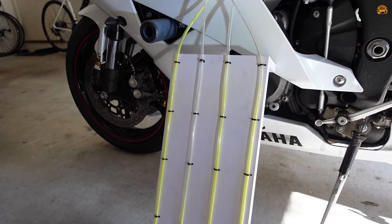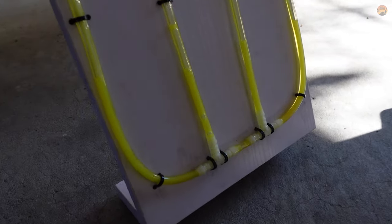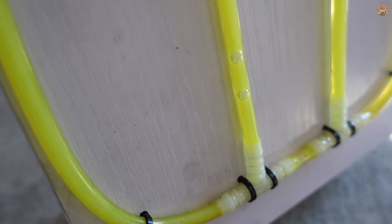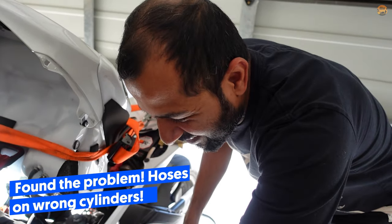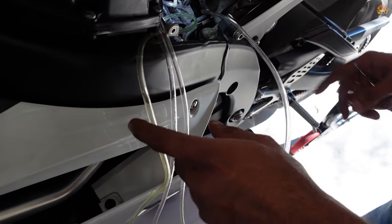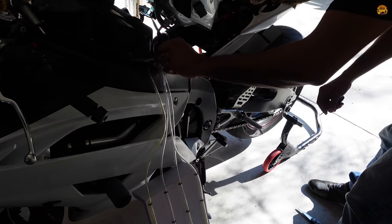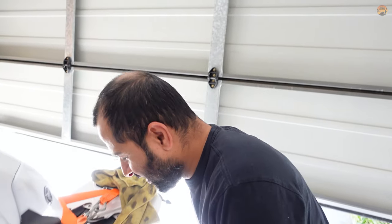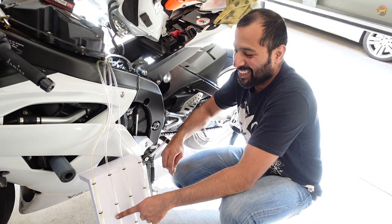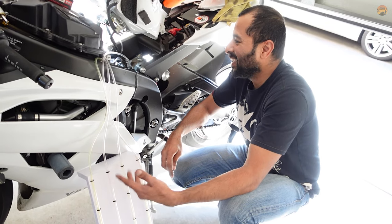The numbers were not right. The hose was going into cylinder two — which is the cylinder you can't adjust. That's why it kept not responding; we kept loosening the other screws and bypassing more air, but the level for cylinder two never came up. So we go back to the previous settings and work from there.